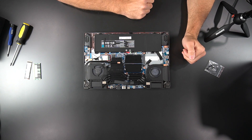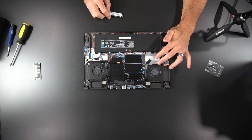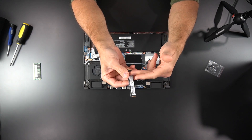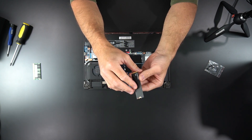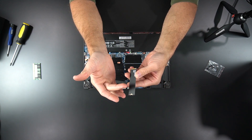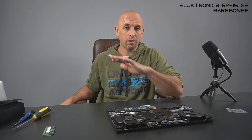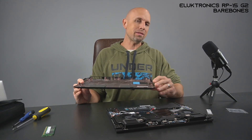Right here we have two M.2 slots for storage. Both are capable of PCIe Gen 4. There's enough space between where it mounts to the chassis for chips on both sides. This is a 1TB drive — the commercial 980 Pro, the PM9A1 — and there are no chips on the other side of the PCB. But once you start getting into a lot of 4TB drives or some 2TB drives, there are going to be chips on both sides, and you will have no problem getting that to fit. PCIe Gen 4 drives haul some butt, and there's actually a built-in thermal pad and metal plate that will make contact to dissipate some of that heat, so under long read and write sessions it doesn't fall flat on its face as quickly.